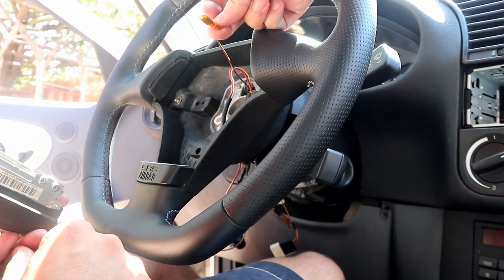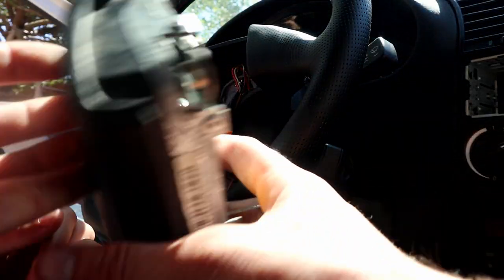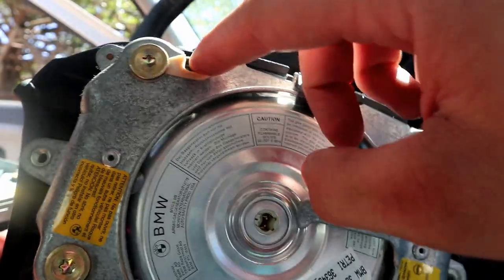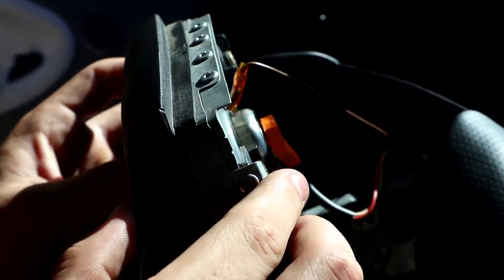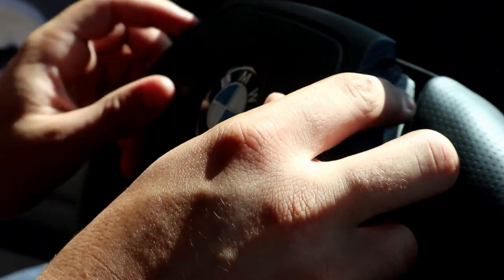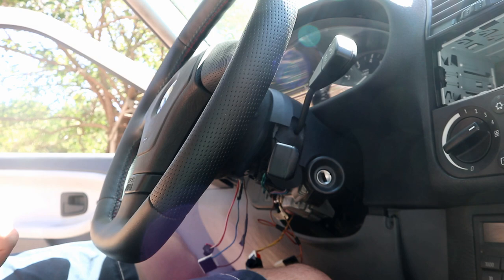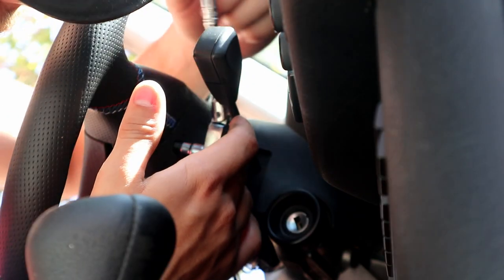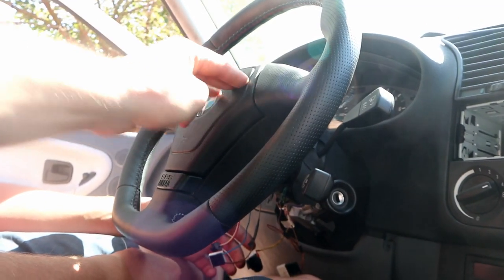For the airbag connections, connect the ground connection onto the tab, and then the center plug goes right in the center. This is the factory airbag, so we have the connection right in the middle and the ground tab up in the top left corner. The ground will just wiggle on. Now place the airbag into its home. You might need to push the airbag into the wheel as you tighten those torx bolts down. When it is all done, the airbag should be nice and tight and feel like a horn when pressed.